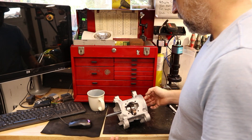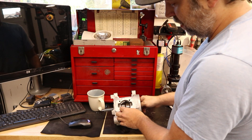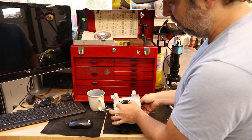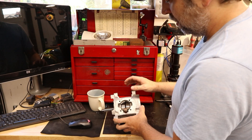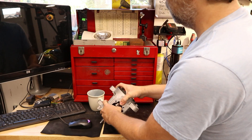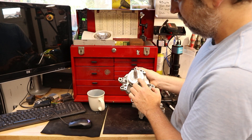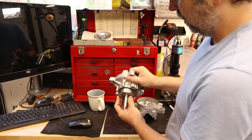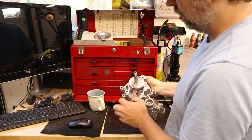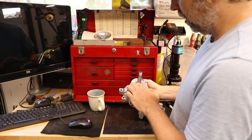How do you go about doing this? It's actually pretty easy. The difference between these two cranks is within about 20 thou — the Piaggio one is 20 thou narrower than a Honda Hobbit one — and it fits within the cases no issue whatsoever. The diameters of the webs are also the same, so it fits in there too. This is an 85mm con rod Piaggio crank made by Stage 6, but pretty much all of them work. You can get these in 80, 85, and 90mm con rod lengths at various prices.